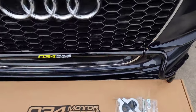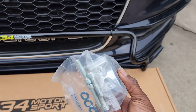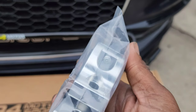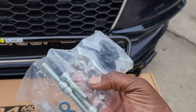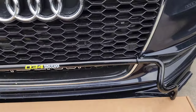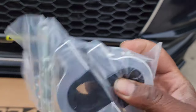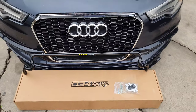034 is making nice quality parts — look how thick the brackets are. They put a zerk fitting on there so you can grease them later without having to take them off. You just get a grease gun and hook it up. Sometimes these will squeak later, and if they do you just snap the grease gun on there and it'll stop the squeaking.